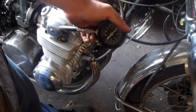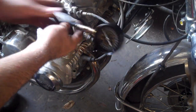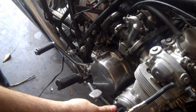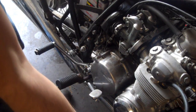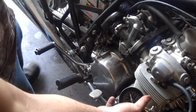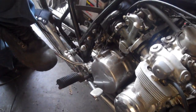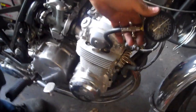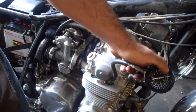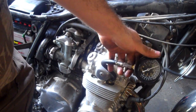Now I'll show the kick start method. Press the purge button to reset the gauge, then kick the bike over four or five times until the gauge needle stops rising. You need to hold the throttle open while doing this. That method gave me about 110-112 psi — a little bit better and actually a little encouraging.